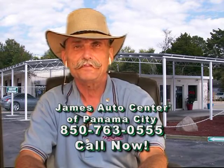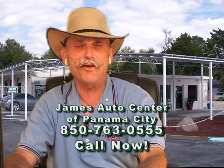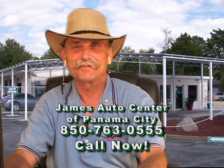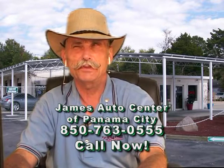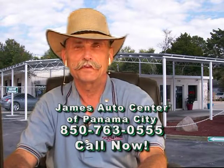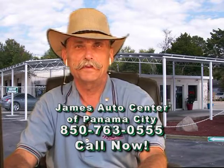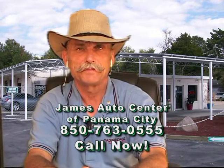It's a 2001 Audi TT Quattro. What happened is the key got busted on it and it's been glued back together. I'm wondering if this is the key problem, but whenever you start it a lot of times the tach won't move, the gas hand won't move — it's like it switched off, but yet it'll still start and run.